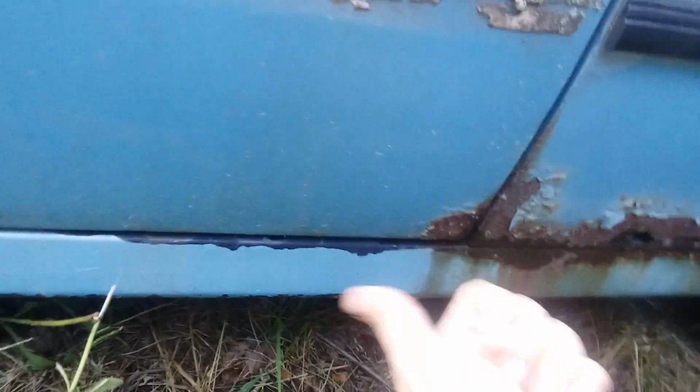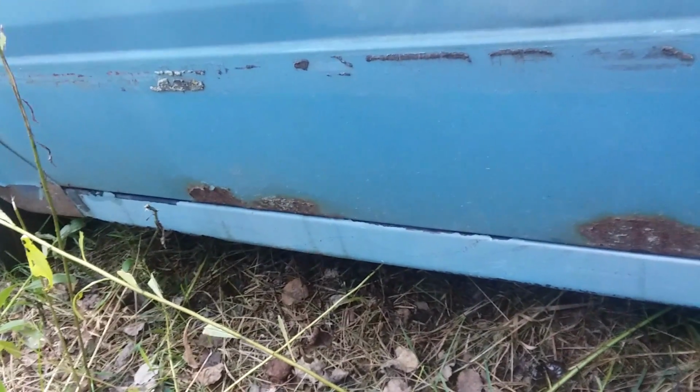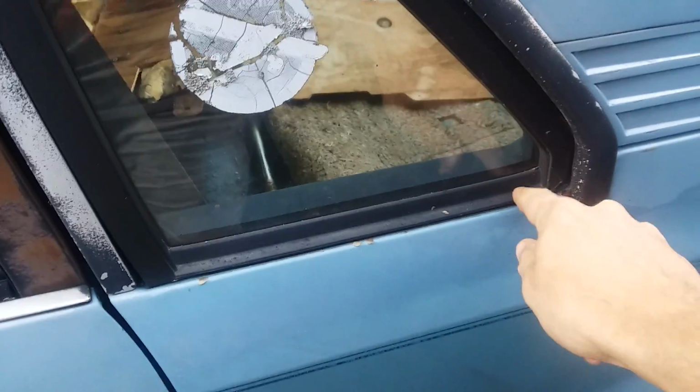And I think the reason why the rocker doesn't really rot is because it has holes drilled into it at an angle like that into the bottom. So when it goes down the road, water travels out from each of the, it's somewhere between 6 and 10 holes that these usually have, that water can go out of. And there's a hole at the end here,